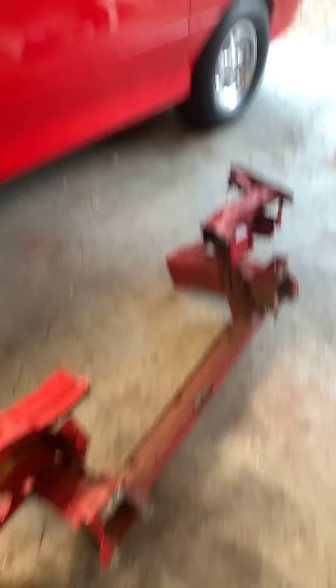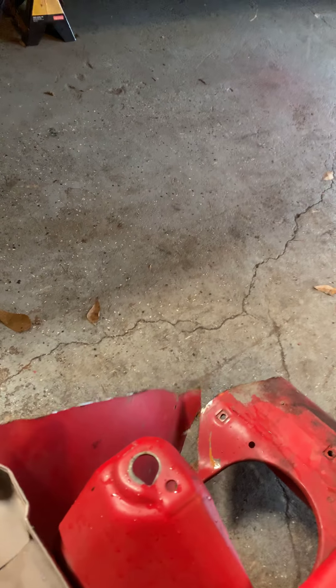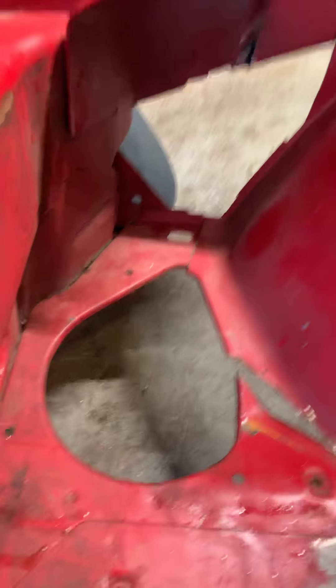Basically what I found when I went to cut this thing — to get to the point where I'm ready to weld — there's a lot you gotta do and a lot you gotta look at to cut your car up. It kind of drops down right there on that inner fender where the battery mount is. You're definitely gonna have to relocate your battery. The front end is chopped, so I'm hoping this makes sense and helps people out.